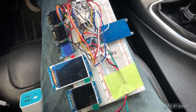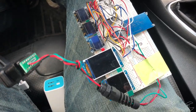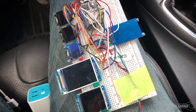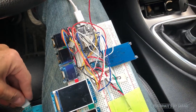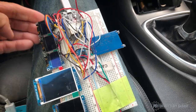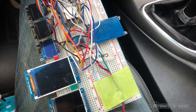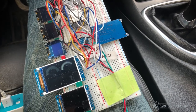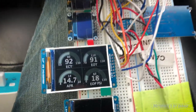This is another device that I've recently just put together and today actually was the very first test drive. These wires here — as you can see it looks like an OBD port because it is. That hooks up to the car's CAN bus. So this device is on the car's CAN bus and it's also going to connect to the Bluetooth server. Let's plug it in here. So this happens when you've got all these wires — they can kind of get loose and then things don't work as you expect. We'll just try it again. There we go. Obviously in the final version it would be on a circuit board so we won't have these issues.